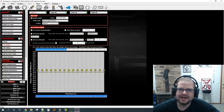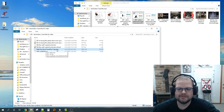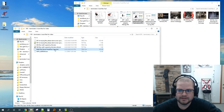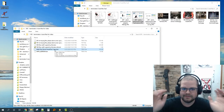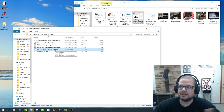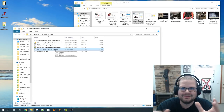I'll get the 'mat flex boost smart fan' tune file up for everyone to copy. The fastest way to get going: get the sensor from Pace, get the plug-and-play harness, grab this file, use the compare feature to dump in all the tables, and your tables are all there. If you're not already using those advanced tables it won't overwrite anything meaningful, but if you do have something in those tables and you copy my stuff over, you will overwrite it — another reason to save many versioned files.